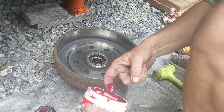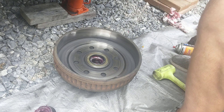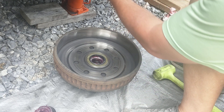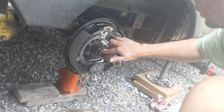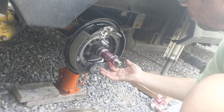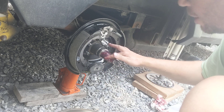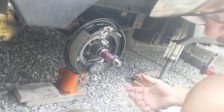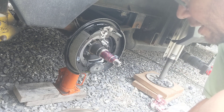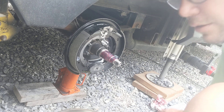Get a little grease on the spindle here — just put a light coat. When you get some grease on the spindle, go ahead and feel around for it. Make sure it's not blued. You're probably going to have some wear marks underneath here, but as long as this isn't pitted or scarred, that would give you an idea that something's not right in there. Now if you do have any grease on this hub right here, go ahead and wipe it off, get a little brake cleaner.